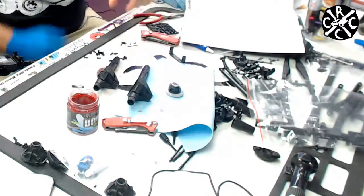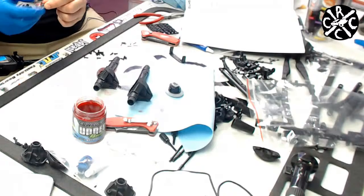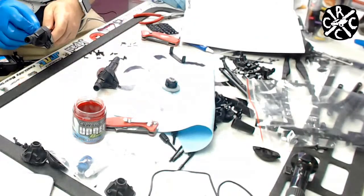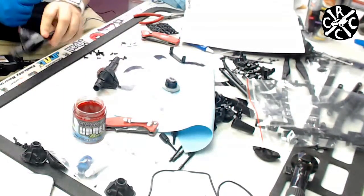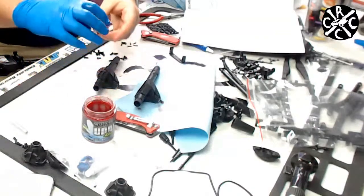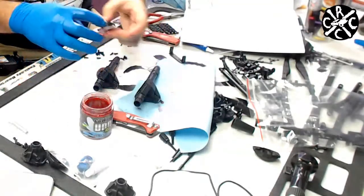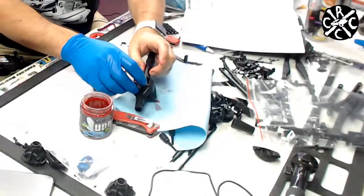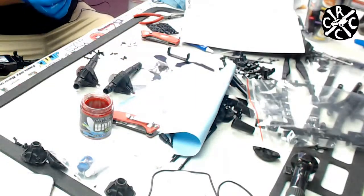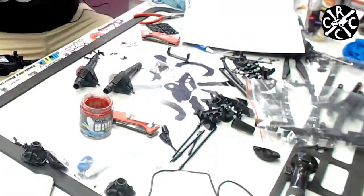All right, so getting back to where we are with this, just need to put some grease onto our pinion gear, and we need the axle. Push it through. Good to go. Now again, be careful. You got to do this right. This goes on the opposite way. I'm doing these like this because I don't want to have to do the glove over and over. So while I have to use the grease, I'm going ahead and trying to get these things knocked out. You will notice that these are opposite directions, and that is how it says to do it in the manual. I am just following the manual to make sure that when it's all put together, you don't have to take it apart and flip one of them.